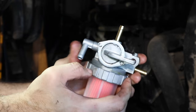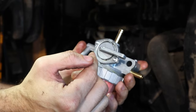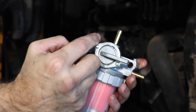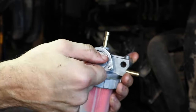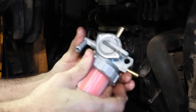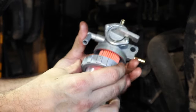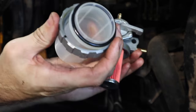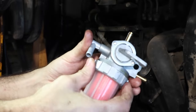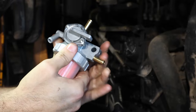On these particular Mitsubishi fuel assemblies you've got an off/on and air bleed switch right here, so there are no screws to air bleed it — you simply flip this switch over to bleed it out. The bowl assembly on the bottom is just hand tightened, so don't over-tighten that. It's got an O-ring that sits up against those threads. So we're going to reconnect our bowl and hand tighten it, not too tight.